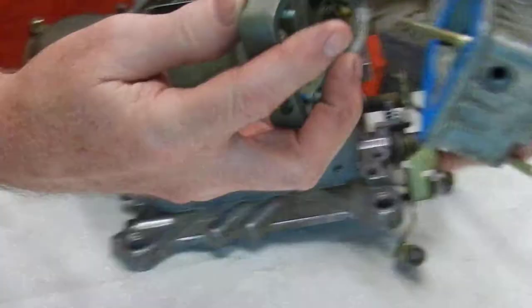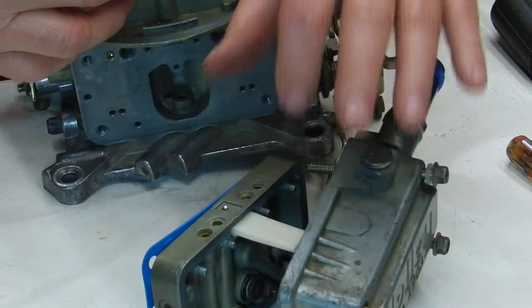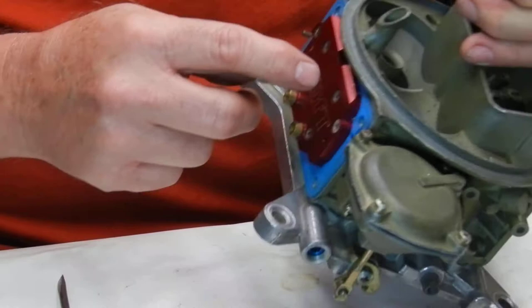That will take care of usually the front, because if you look at how this vent is sitting in here — the fuel in the fuel bowl is putting the vent almost all the way to the front — it just about eliminates the fuel coming out of the top of the vent hole.